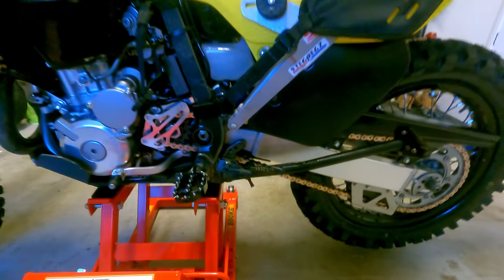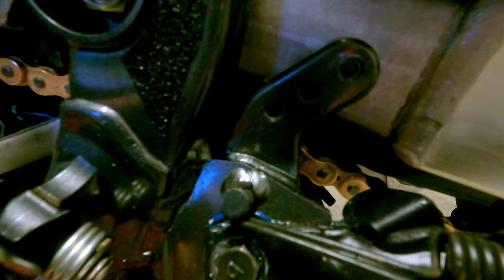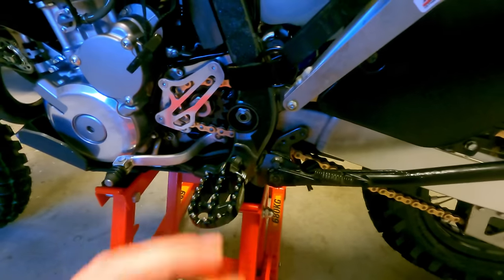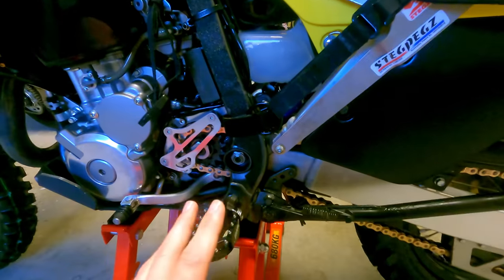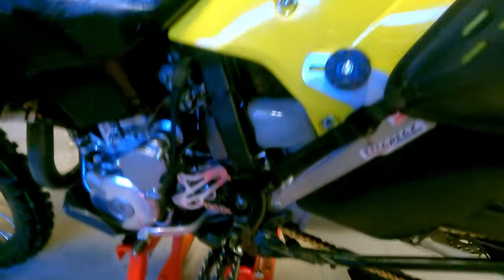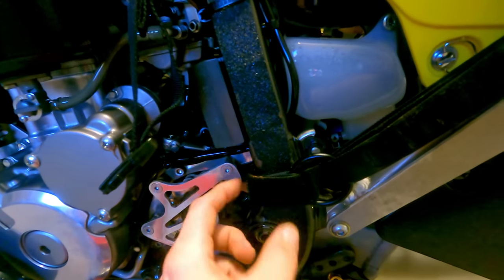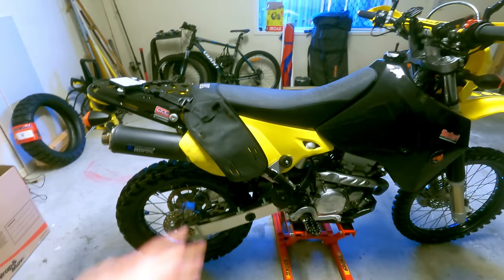The next thing I went and done was something I've wanted to do for a long, long time on this bike - removing the side stand switch. When your stand is in the down position, the bike registers that and it won't let you ride off with the stand down, it cuts the power. It's been an issue on this bike - when I stand up, my heel sometimes hits the stand, or if you hit a big bump the stand drops a tiny bit and you lose power for a split second. And while we're down here at the stand, I've added a larger base plate, which should help when I'm on sand or soft ground to hold the bike up a little better. I've also added these OS dirt bike rings - they come on Velcro straps that wrap around the frame, one on either side, and it's really evened up the way these bags sit so it should sit much nicer and more even. Pretty cheap and easy mod to chuck on.